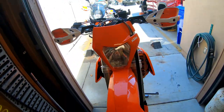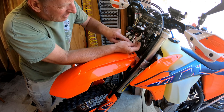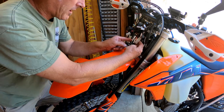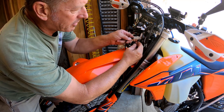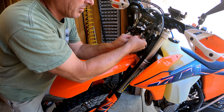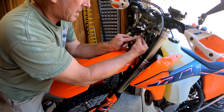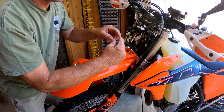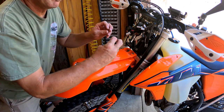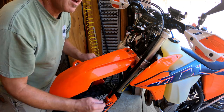The first thing I'm going to do is take off the front headlight shroud to get access to everything behind there. Now the number plate is off and I can see lots of connectors that need to be greased. The grease goes in the backside — just dab a bit in there, massage it in with your fingers, then take them apart and get a little in both the male and female sections. A couple connections under the seat have seals on them, so be careful — too much grease can hydro-lock those. Out here none of them have that issue, so let's get started.